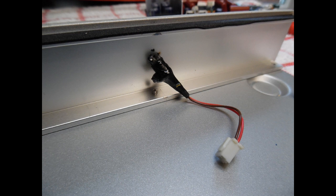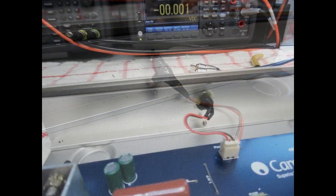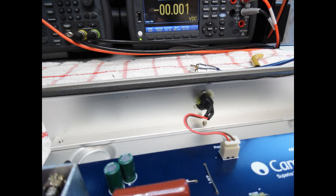Looking at the LED on the front — Cambridge Audio seemed to use something like a black tar to secure it. No matter how carefully you remove the outer cover and unplug the LED, this black gunk causes the LED to just drop off the case. You always end up having to feed the LED back through the small hole and re-secure it. I show a before-and-after shot: after cleaning off the tar, I use a quick-drying epoxy resin, mixing the two tubes and spreading it with a small flat blade screwdriver. Keeping it in position for 10–15 minutes gives a solid, long-lasting repair.